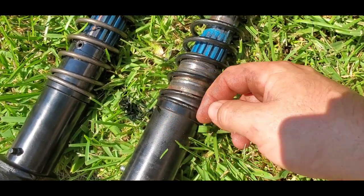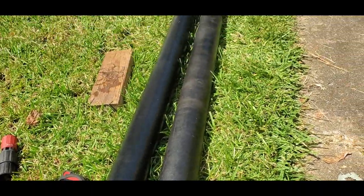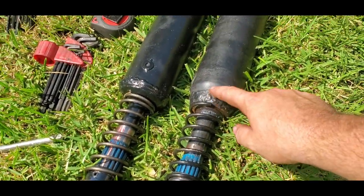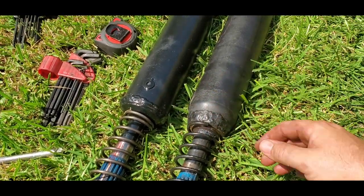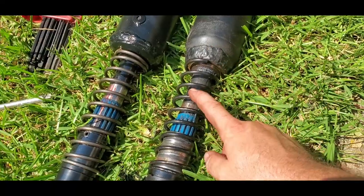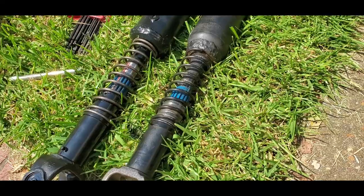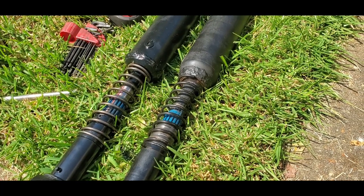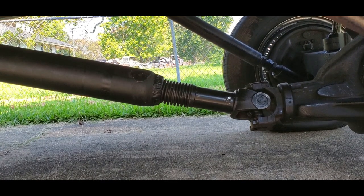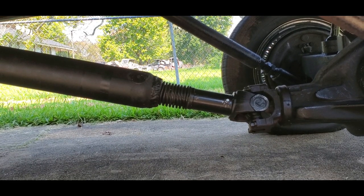That's the reason I didn't cut it down at the other end — there's like no shoulder whatsoever and it would definitely just unscrew. These driveshafts both have a nice six-bolt Cadillac flange but they are different. You can see up there where the narrow part gets wide — they're totally different. I did pull them both from Fleetwoods: this one was out of the Blue Rose, this one was out of the tan Cadillac. We're gonna throw this in the car. If it works, it works. If not, I may just have to deal with the noise or shim it down a little bit. Now with the car fully locked up you can still see light between the spring coils — they're not butted together — and I think that was what was making my noise.